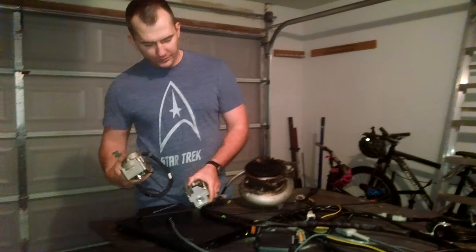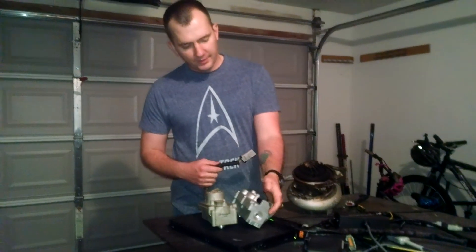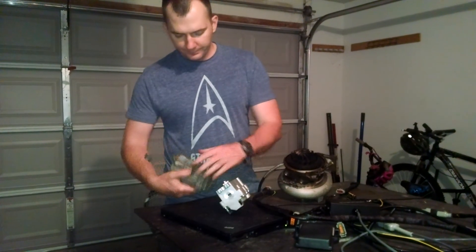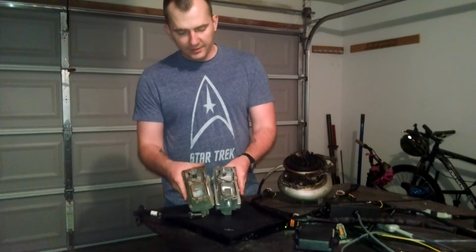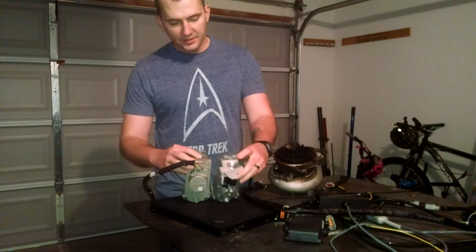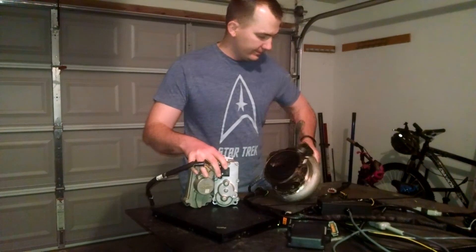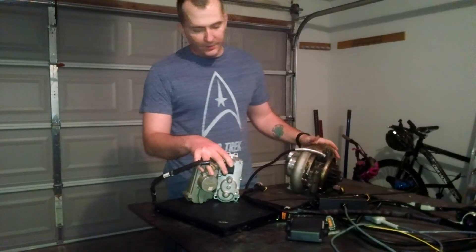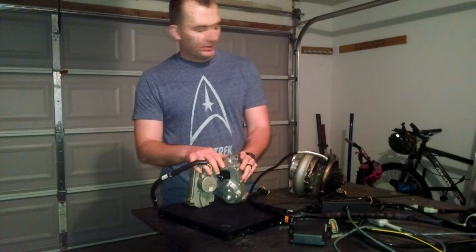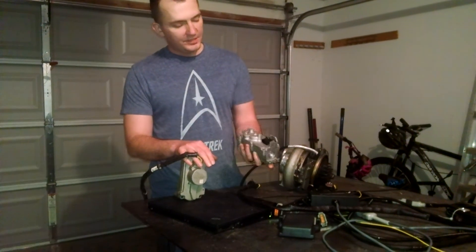Looking at the 351, the actual casings are actually different. The connector on the 300 is actually on the actuator, where the 351 has a pigtail. If you flip them over, they're exactly identical for the most part. The difference between the casings as far as the actuators is just an additional port — it could be a drain or it could be the water inlet. So you can either tap off the water inlet here and use this one as the inlet, which will cool down the actuator before it cools down the turbo and save the electronics, or you can use this as your inlet and have a second water output. It's kind of up to you how you want to do it.